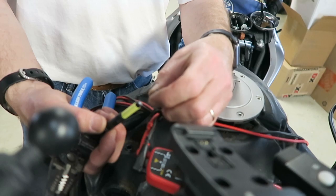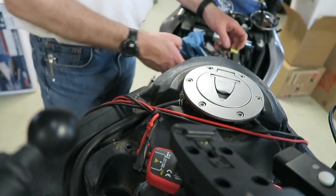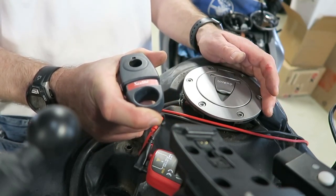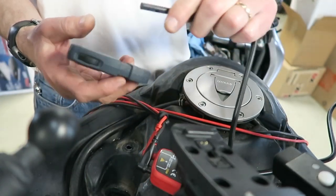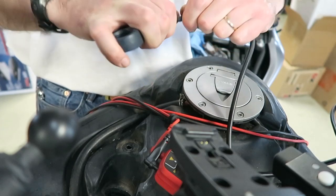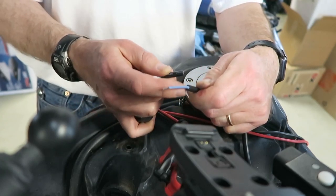I really hate to take these grips apart, but they don't work in my application, so I cut the ends off. The other thing that I have is an Exolite. I use this stripper for stripping coax cable all the time, but it does come in handy when you want to do something simple like this. If you're trying to expose a little bit of the cable, you just put them in here and spin it around a couple of times, and it will break the cable for you so that you can pull the cable ends out. It has a really nice hermetically sealed end on it, and it doesn't break the inside cables.